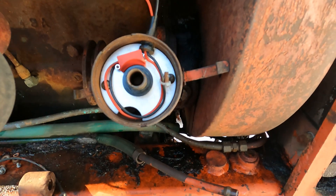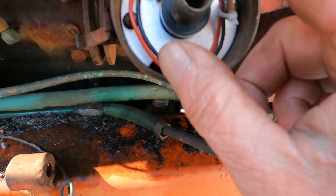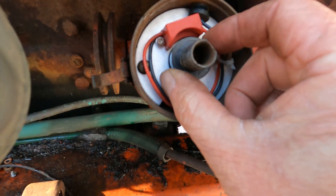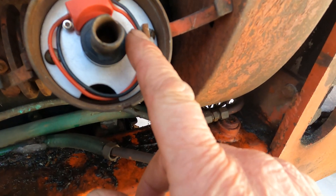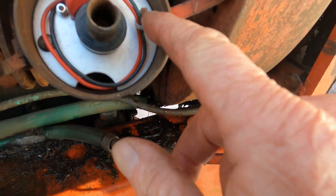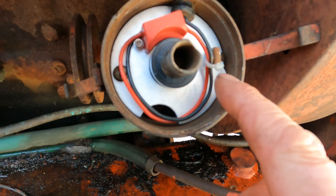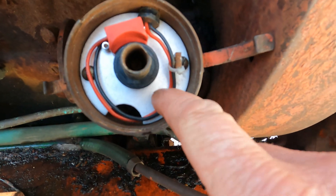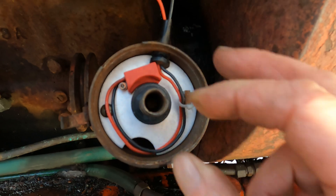Okay, we have this in here — it's a nice little setup. This magnetic sleeve went on real nice, nice and tight. It says zip tie the wires if you can. I used the ignition points' little angled piece that had a hole in it, so I hooked the zip tie up to that — not too tight, but it should keep the wires out of the way.